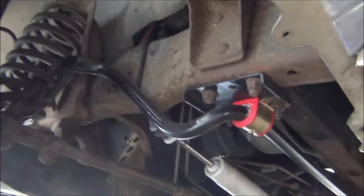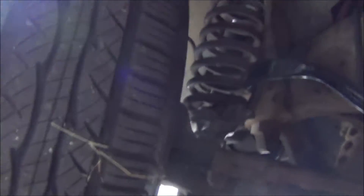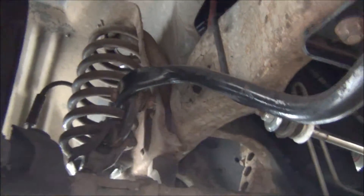In high speed you get to see me address this issue. I'm also going to work on moving this sway bar bracket forward to the link, so the sway bar will line up better. As you can see it's a little off, and then we might be able to make this a little bit more effective than it already is.